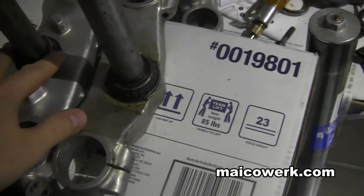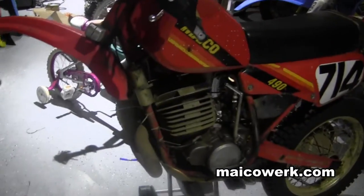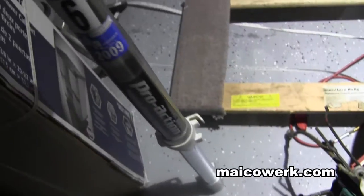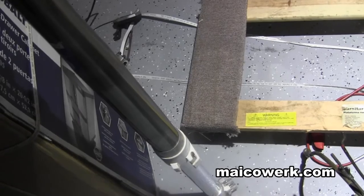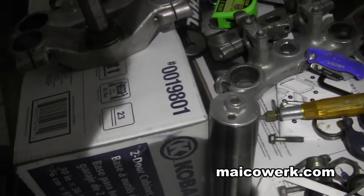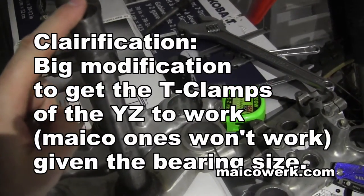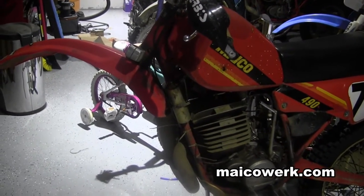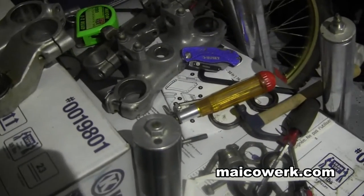Instead of trying to do something like that, I can just make these bigger, so that would help get front disc brakes. This here is a newer YZ250 front end with upside-down forks, and I was going to put these on, but in order to do that it would take a big modification. I was also worried a little bit about how the frame would handle upside-down forks, and I really don't need them.